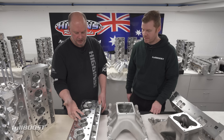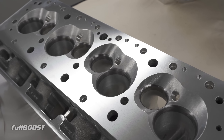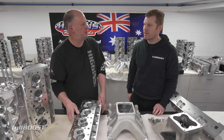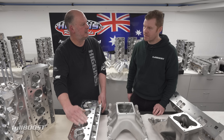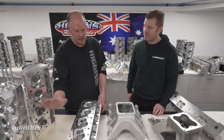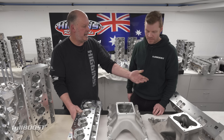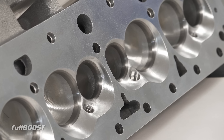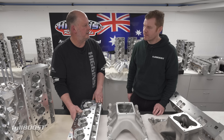There are a lot of differences. It's a cant valve for starters, which means you've got 11-degree intake and 4-degree cant. As lift goes up, it's always going away from the bore, so it's fully unshrouded. At 11 degrees, once the lift gets to a certain height it's unshrouded again — it's out, there's no chamber. With an 18-degree or 13-degree head, you've got that awful chamber that comes right up around the back of the valve on the spark plug side, so it's always shrouded.